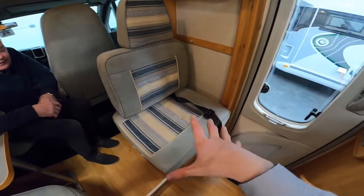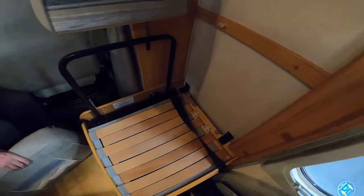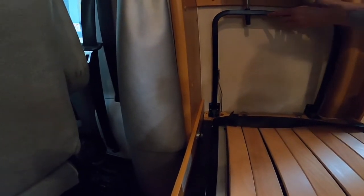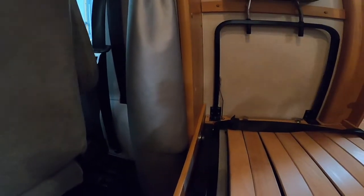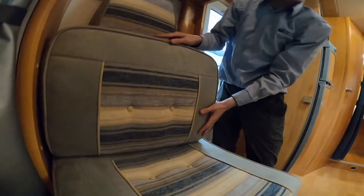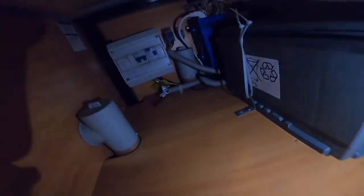This is how to convert the side facing bench seat into a traveling seat. This is your backrest and that's your base. The frame lifts out - unclip this, which is just a safety feature, lift it out and it will clip into here when you want to make this seat a fifth belted seat on site. You put the two catches at the back of the straps to stop the cushion from falling off when traveling - they just clip on. The backrest goes just under there.